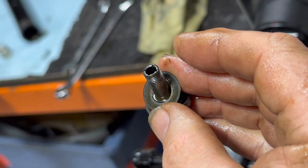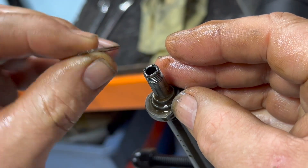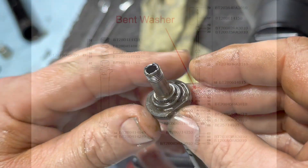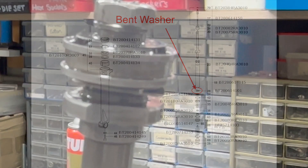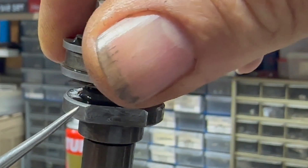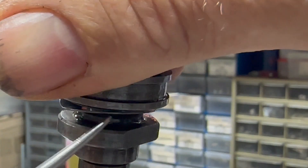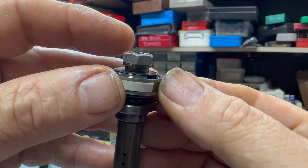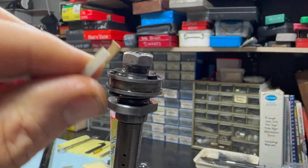On the other side of the piston, once we pull this off and clean everything, you should have a flat shim washer — you can see that. But underneath that there should be a very similar washer but bent — it's missing. These break often because they're always bending. That bent shim washer is there to put pressure onto the flat washer underneath it and hold it against the piston. I've rebuilt this and put a bent shim washer back in — you can see it there. That bent washer holds the one underneath it flat against the piston, controlling oil flow — as there's more oil flow, the washer bends and allows oil to pass through.